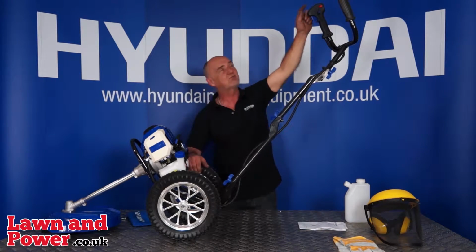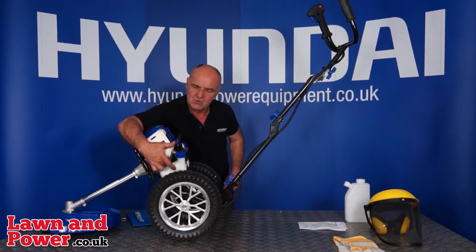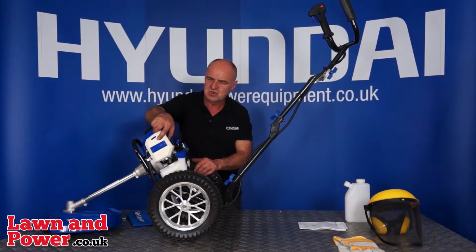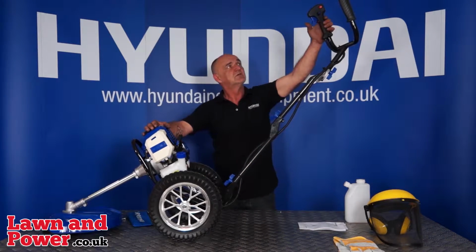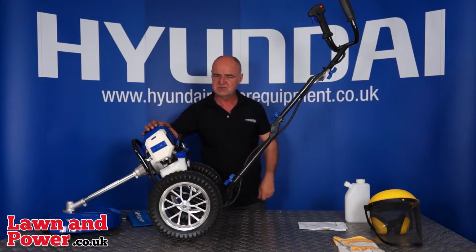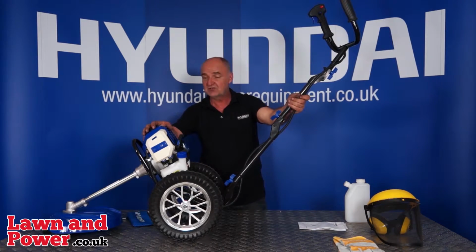So just a quick recap. To start, switch on. If it's cold, and you haven't started in a while, prime, choke on, pull start. After a few seconds, turn the choke off. That's to rev it up and go. Off you go, doing your strimming. When you're finished, let go of the throttle, let it sit there for a couple of seconds for the engine speed to drop down, and then switch it off. And that's how you would start and stop the machine.